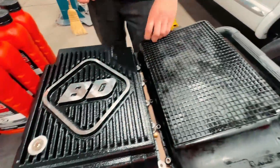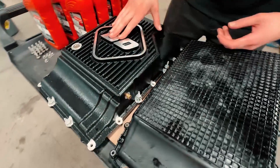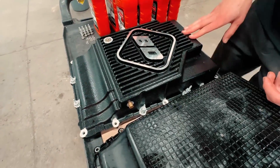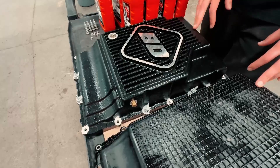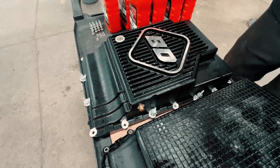Kind of gross. And finally, you can see a big old height difference here. This guy adds 2.1 quarts of fluid capacity, so instead of putting 5 quarts in to start it, we're going to put 7 in, and it should use right around 9 to finish — hence what we've got here.